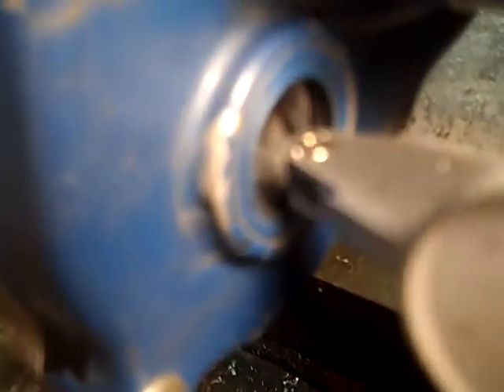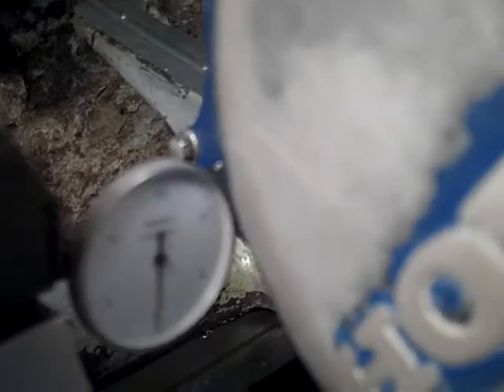The repair is welded and sanded down pretty smooth. The clutch cover is back on with three screws and the alignment pins, and I've indicated the kickstarter hole — got zero all the way around.